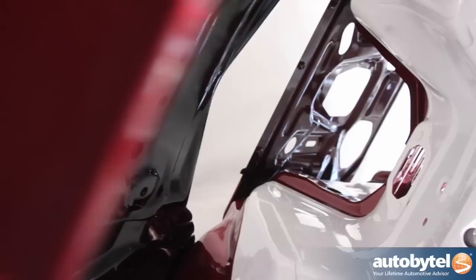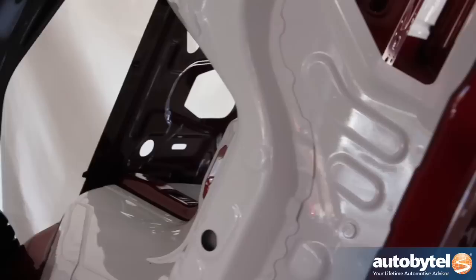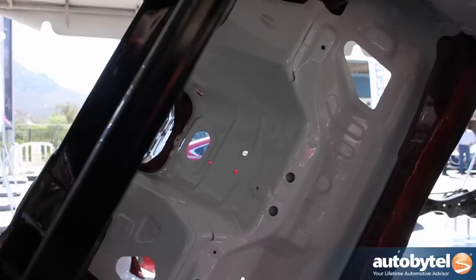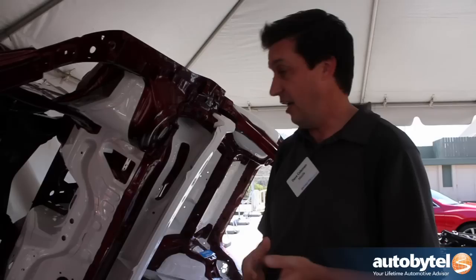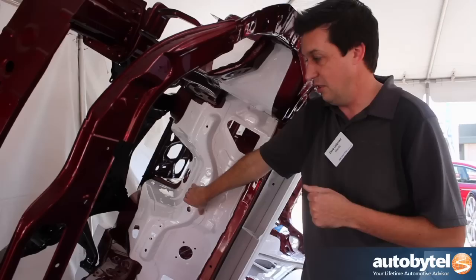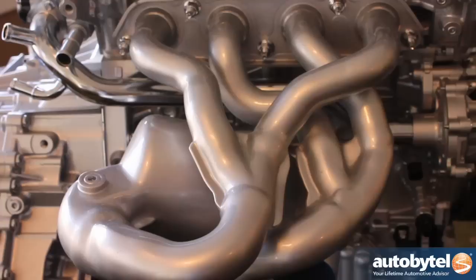This is the body shell of the new Mazda 3, and this is a good example of why designing the whole car at the same time is important. When we designed the engine we really wanted to get the highest compression ratio we possibly could, because that's fundamental to getting the most energy out of the fuel we're burning. But there are a lot of challenges to running high compression — the biggest of which is that it will typically cause detonation or knocking, which can damage the engine. By designing the body at the same time, we were able to design the engine differently. This structure here in the firewall — you can see this reinforcement and this very big tunnel, which is unusual for a front-wheel-drive car — was made to accommodate some design features on the engine that were absolutely necessary to get the compression where we wanted.